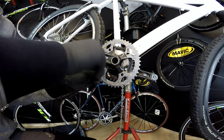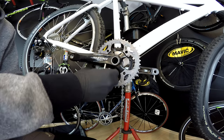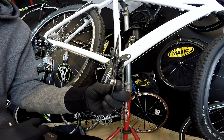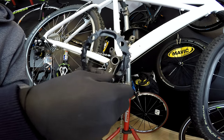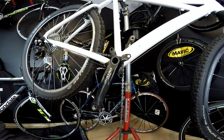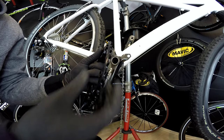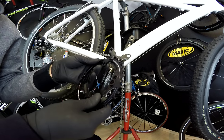I've put the largest and middle chainring together here. I'm going to unscrew the old one and show you the difference — the difference between the narrow-wide chainring and the standard one is huge. These are two-piece bolts: an inner side and an outer bolt, and that's how we mount the chainring to the crank arm. It's called narrow-wide because the teeth alternate: narrow, wide, narrow, wide.